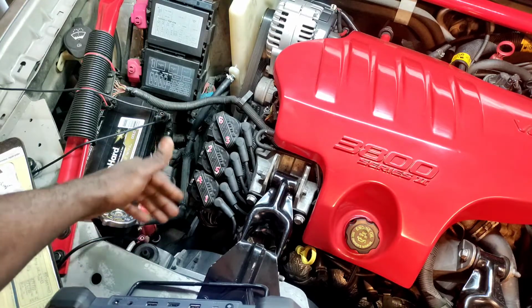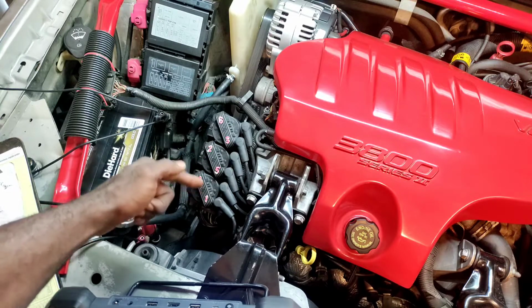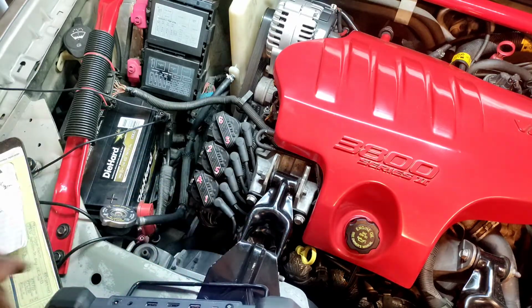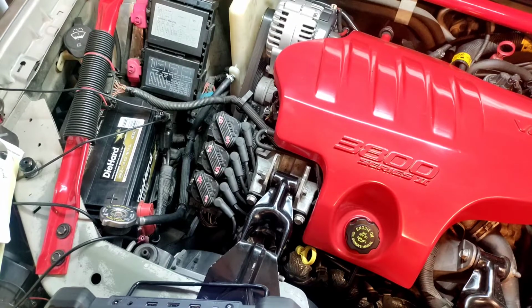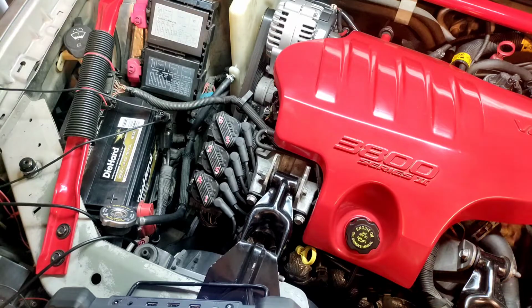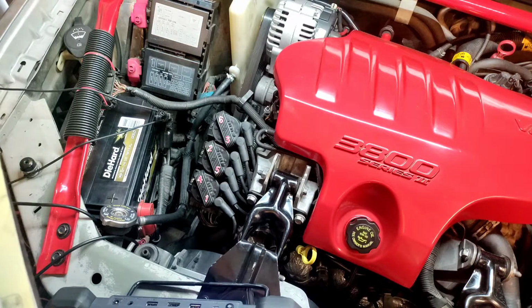It only provides an input signal, a square wave from the crank sensor, and then that signal goes back out to the PCM. And it should be displayed in the wiring diagram. I'm either going to have it as I'm talking, or it's going to be at the very end of the video. But this does not have a CAN gateway system in the ignition control module.